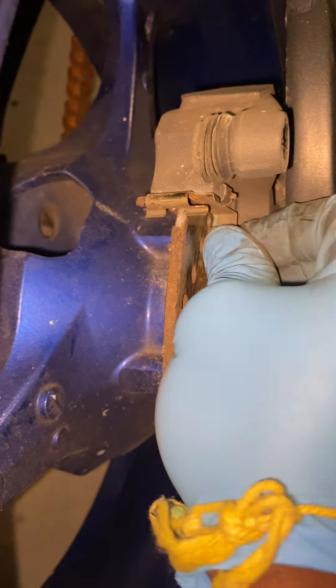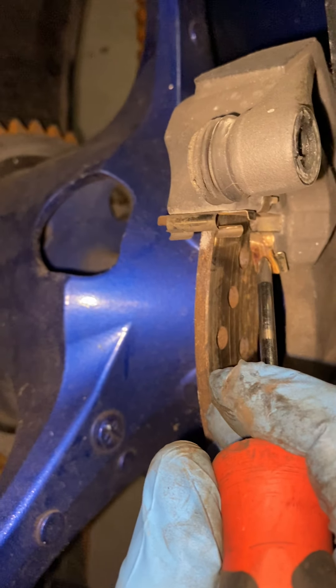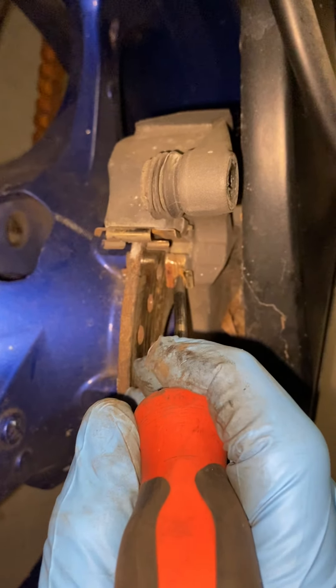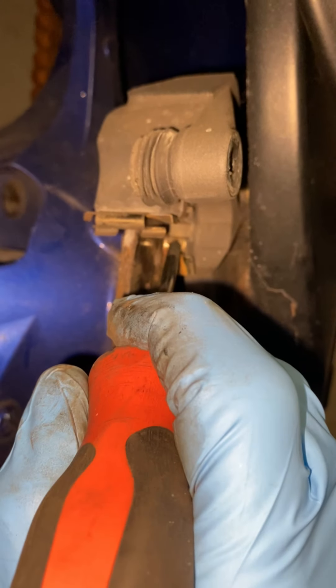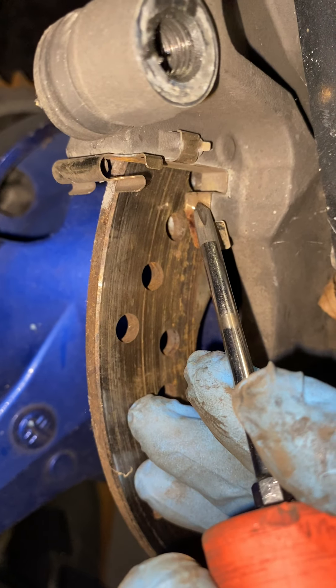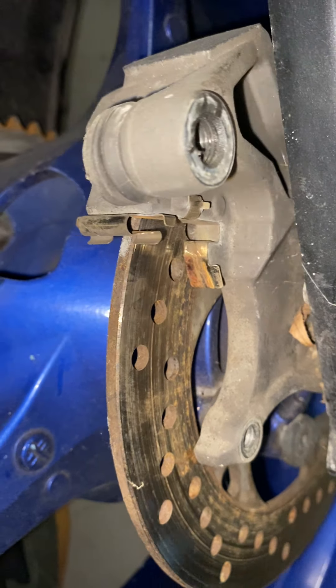This shim right here is very important. If it's bad — corroded like this one is — you might have the rear brakes dragging. Once you activate the rear brake, everything's supposed to slide back smooth, and if these grooves aren't smooth you're gonna have the pads hitching a little bit. That's no good. You can take that off and scuff it up with a pad.